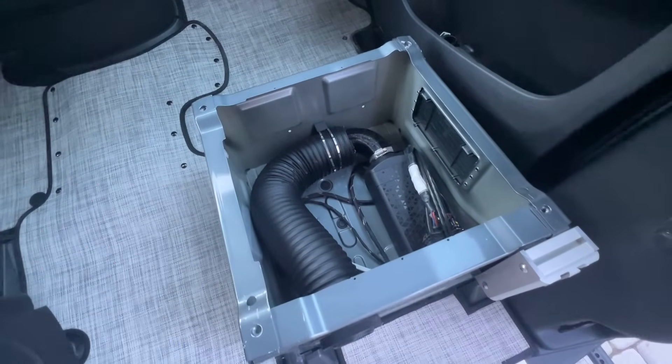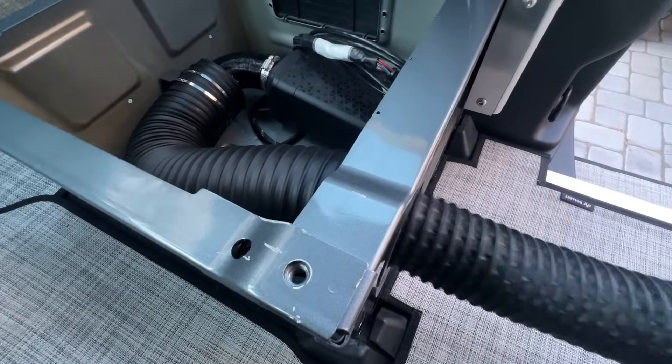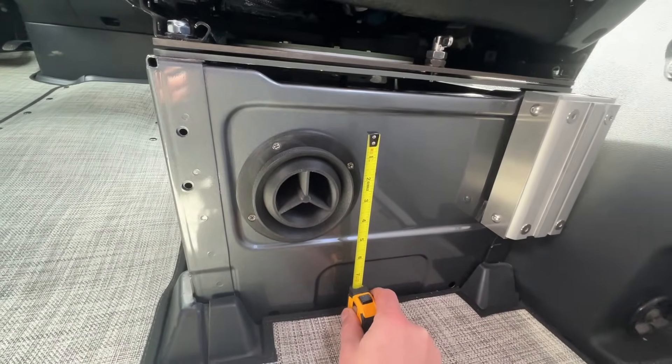I have my extendo vent installed in a pretty common location — underneath the passenger seat — but I'm very aware that not everybody has their diesel heater there. I really wanted the extendo vent to work for every single diesel heater that exists, as many as possible. So I've designed it to use two different kinds of duct: the compressible and extendable duct that lets you pull it out and redirect air, and the canister housing duct that sits outside of it, which is also very bendable and flexible. If you have a short cabinet you can create a quick bend off the tip, or if you have a long skinny cabinet you can keep the housing straight. Any diesel heater with a three-inch or smaller output hose should work, and you need about a five-inch by five-inch space for the vent itself.